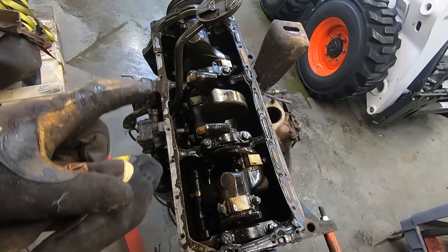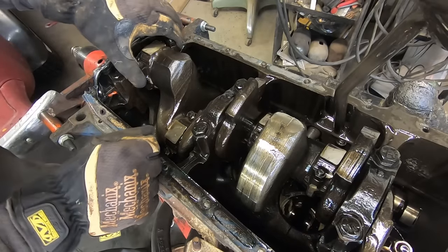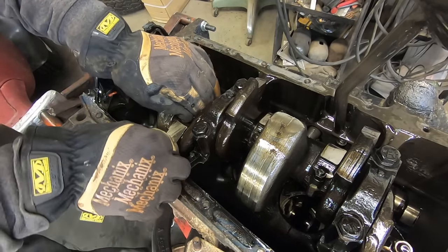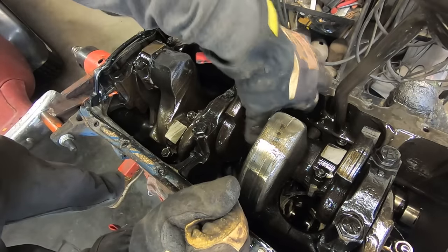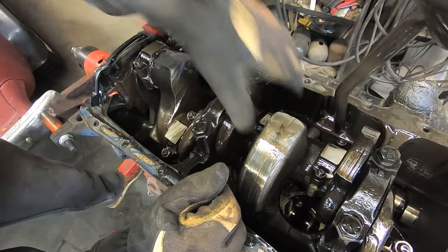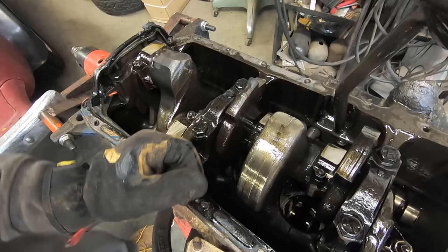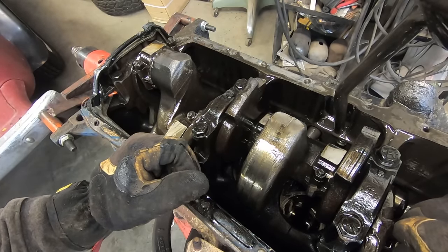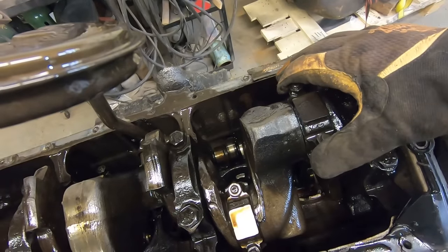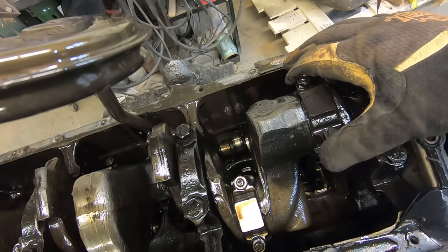Let's see if we can find out which rod is knocking on heaven's door here. Six. Oh, pretty tight. Five. That's moving fore and aft, but they can all do that. Which one's the last one to get oil, you suppose? Found it. There's your problem. Numero uno.